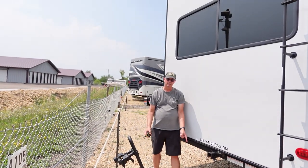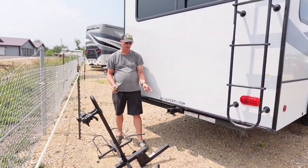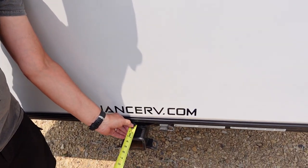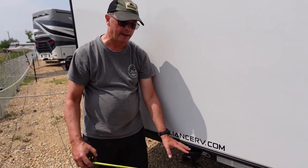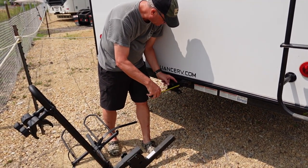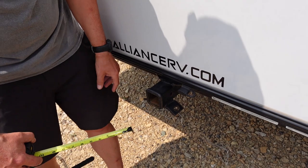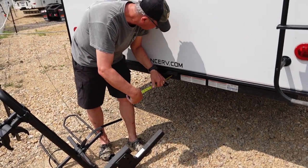I'm not going to go through the whole assembly of the bike rack, but I want to show you how we mounted it on the RV, how we get the bikes on there, and how we addressed some issues we had. First, the back of our rig is completely flat. Our hitch extends beyond the rig just a little less than two inches, maybe an inch and three quarters. That's important for the dimensions of the rack. Hollywood says you need a minimum of two inches from the center of the pin hole to the front of the hitch, and we've got about two and a quarter inches. The dimension from that hole to the beam we're mounted on back here is about three and a half inches.